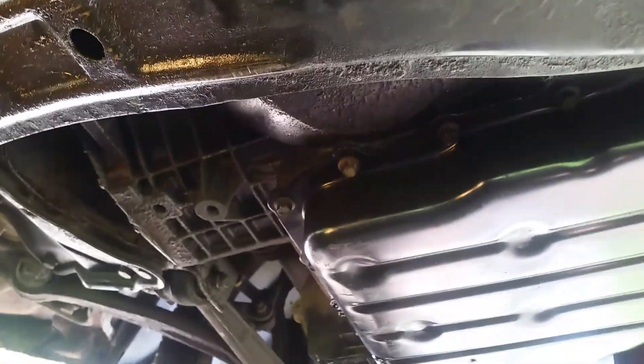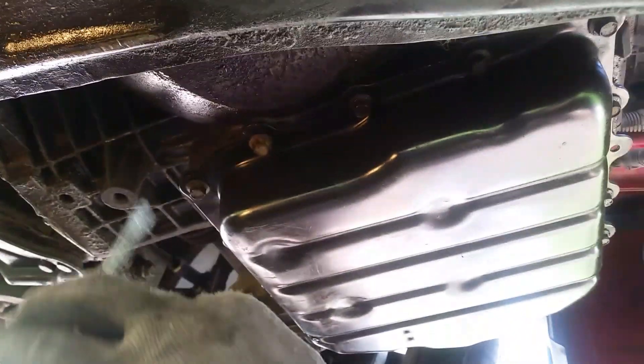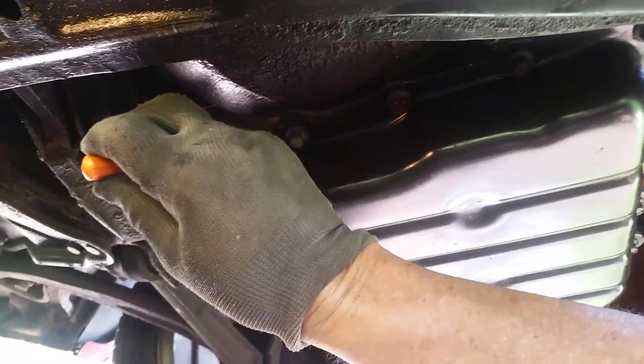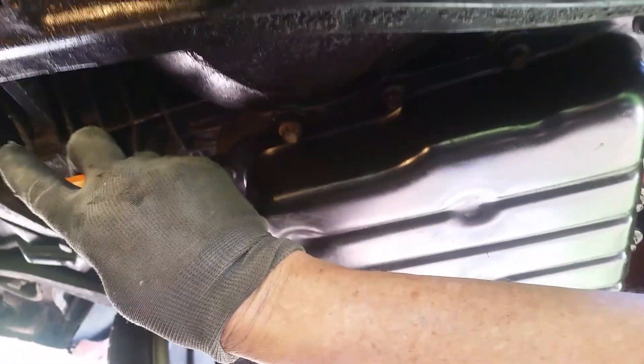All bolts are in finger-tight for now. I should have filmed this earlier, but — before I dropped this oil pan, I had to take a little screwdriver and get in here, because these are really on there from the factory. Sometimes you have to take a screwdriver and a little hammer and tap here, or you can use a claw hammer and just kind of grip the edge of the pan and pull it down a little bit and it'll pop down. But don't take all your bolts out — leave a couple in, because at this angle it'll just pour the fluid out.